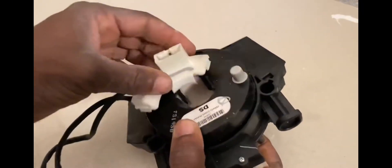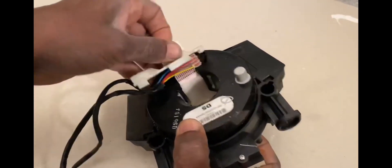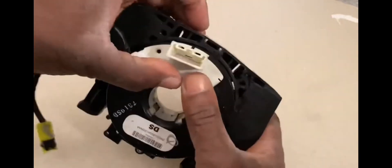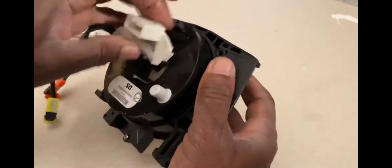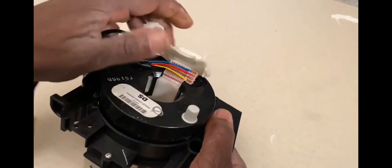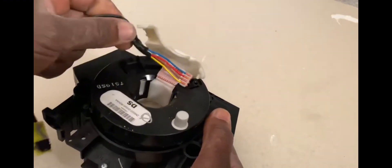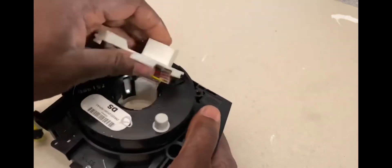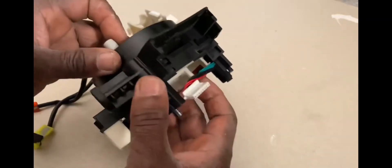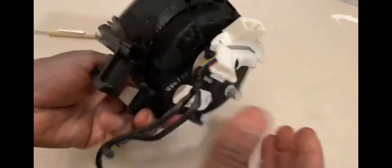If you look for the airbag wires, we have four wires. If you take this one out you can see them through this connector. I took this one out with a screwdriver — this unit is no good anymore, I'm just trying to show you the idea of the airbag. When the horn is not working or the airbag light is coming on at the steering column and nothing deployed, most of the time there is something here that goes bad.